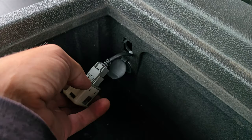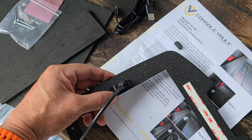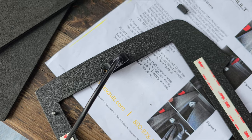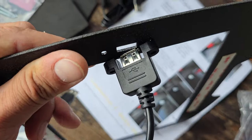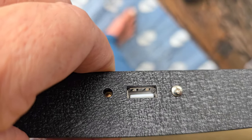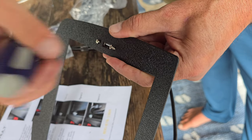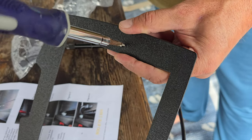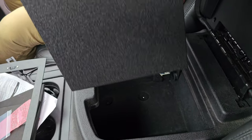Testing out the new code — four ones — hit OK, hear the click, and able to lock. That's it — simple. Set any combination you want. As mentioned, there is a USB port in the console itself, and when you install the Console Vault it will block that USB port. The first thing to do is work with the trim that goes around the Console Vault — it's already notched out for the USB adapter that comes with it. Install using two Phillips head screws, unscrew them, put them through the hole, and screw them back in. Then look inside the vehicle for the small plastic piece that needs to be popped out with a flat head screwdriver — there's a notch on top and one on the bottom. Depress those and the plastic housing with the USB port inside will come out a couple of inches.